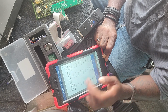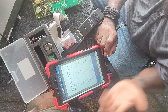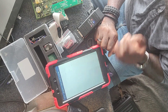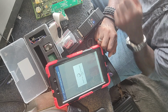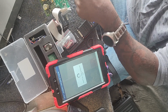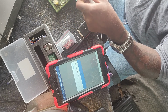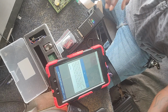Typically you'll work from the bottom up. Sometimes using number 9 for me personally it doesn't work, so I'll just go to number 7. Press OK. Now it's going to generate that key file onto that key. In the meantime, while it's doing that, you can start taking apart back the Cas4 module. Key successfully generated.